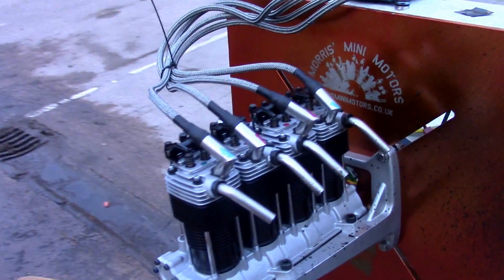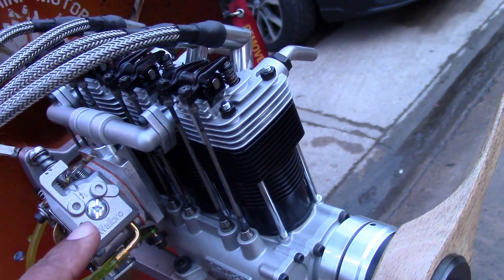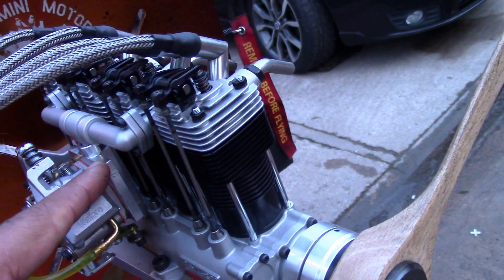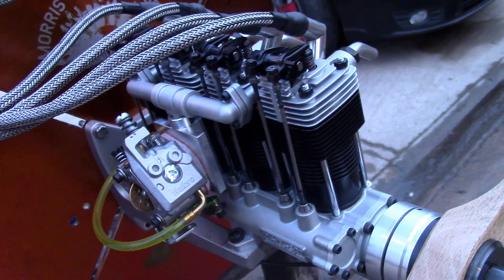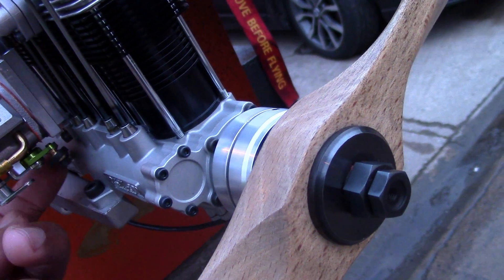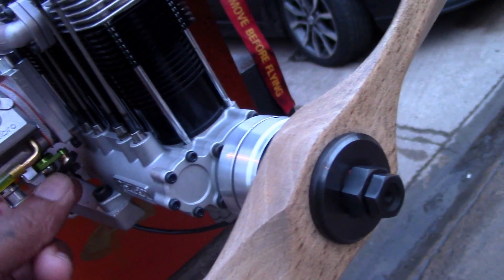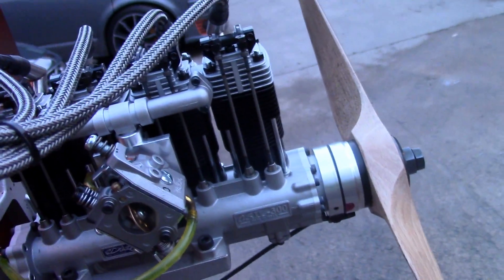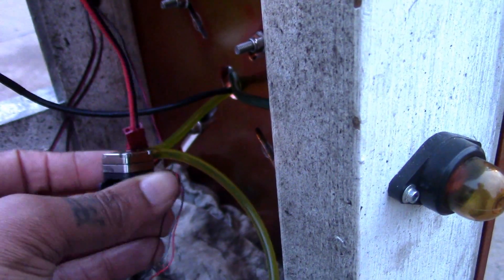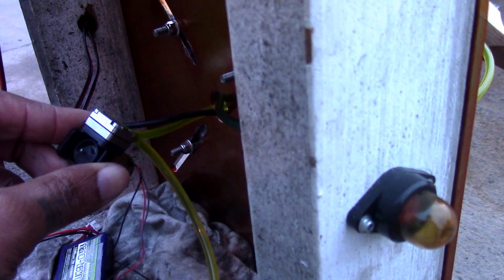Today I complete the Walbro conversion. As you can see, we swap out the original carb, make a carb adapter to connect the T manifold. There's a throttle lever underneath, so no worry about setting up linkage — it has a ball link on it. There's a 3mm ball link that comes standard in the kit, and one line to the carb goes back to the micro fuel pump.